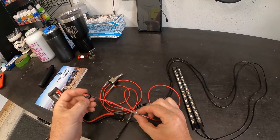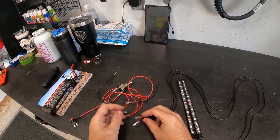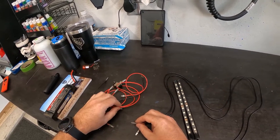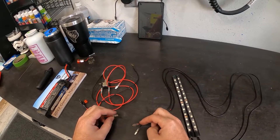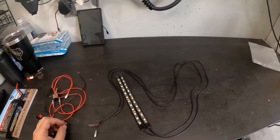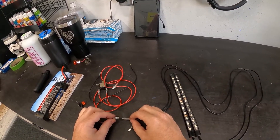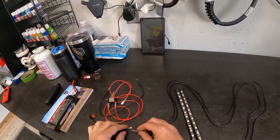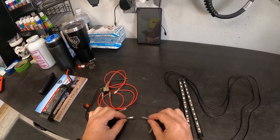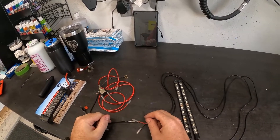This side is just going to go through the add-a-fuse and hook into the hot side — I think the instrument panel. I added connectors so I can plug this in and out, so I can leave all this in the car. If I want to change these or add more lights, all I have to do is unplug and splice the new ones into the series. For today I'm just doing the two footwell lights, though I might eventually run one into the engine bay. The plugs keep everything clean — it stays in the car and I just solder up new plugs if needed.